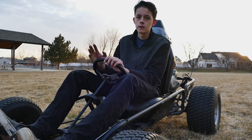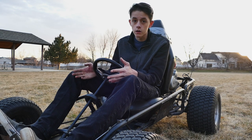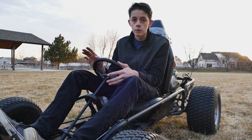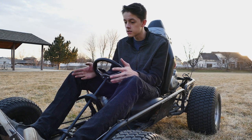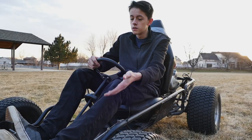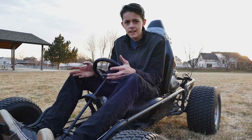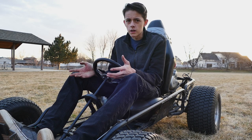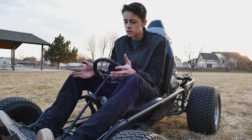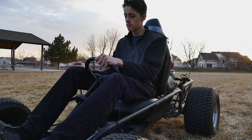In the past two videos of this project, we have swapped a 150cc 5-speed motorcycle engine onto this Yerf Dog go-kart. It drives fine and it's a ton of fun, but the engine doesn't run right, and a ton of other things are just really sketchy, such as the electrical wire throttle, the clutch is kind of held on, the brakes are questionable, but mainly the engine's not running right. It's acting lean, but it also might be low in compression, I'm not entirely sure. So we just need to go home and figure that stuff out. The purpose of this is just to de-sketchify this and make it somewhat safe to drive.